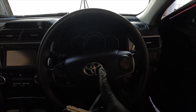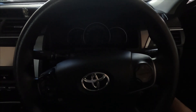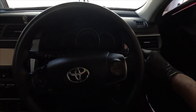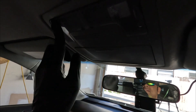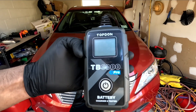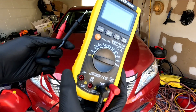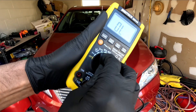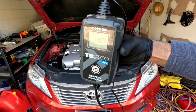The video is a little dark because the vehicle is parked in the garage, but it will brighten up outside. I'm going to start the car — dead as a doornail. Turning on the lights and dome lights shows it's completely dead. I'm now going to test the battery voltage using a battery tester. If you don't have one, you can use a standard multimeter set to the volt position.